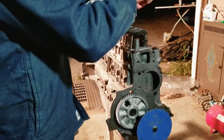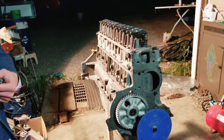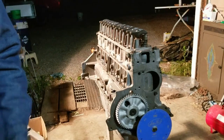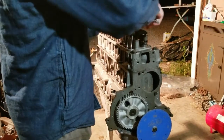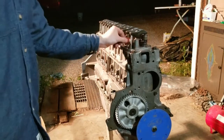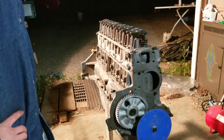Now we go a little further. On small block Chevys, a Chevy straight six — stuff like this — you can go half to three quarters of a turn. I'm going to go three quarters of a turn on both the intake and exhaust, and now they're set. That's pretty much all there is to it.